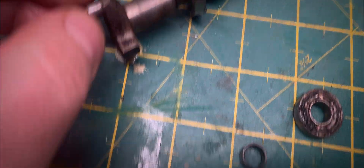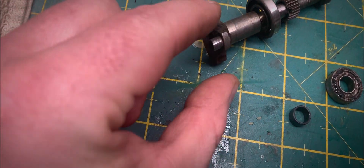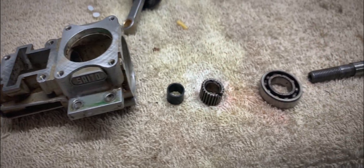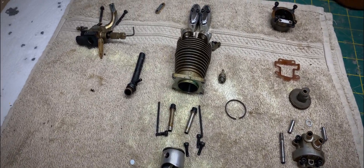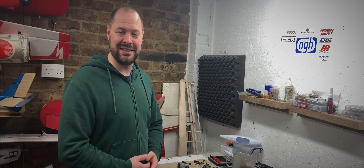I'm learning that heat really is your friend and these can take a fair bit of force. I was able to position it in a vise so it was pushing in the right direction, and as I hammered down that was a lot easier than I had anticipated. Everything's taken apart and ready for a really good clean. I've ordered some premium quality SKF bearings for the front and rear of the crankshaft and they should be arriving in the next couple of days. Is it just me or does anyone else really enjoy taking stuff apart? Join me next time to put it all back together. Thanks for watching.